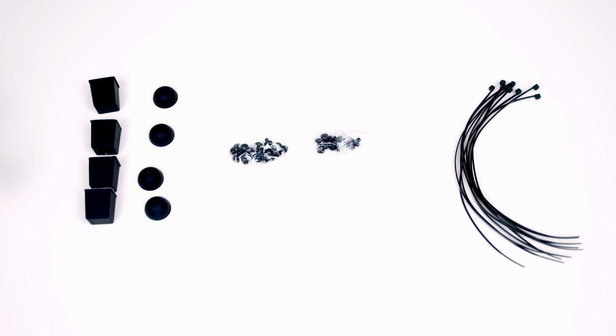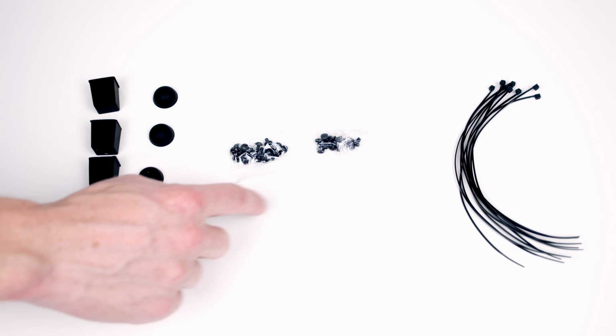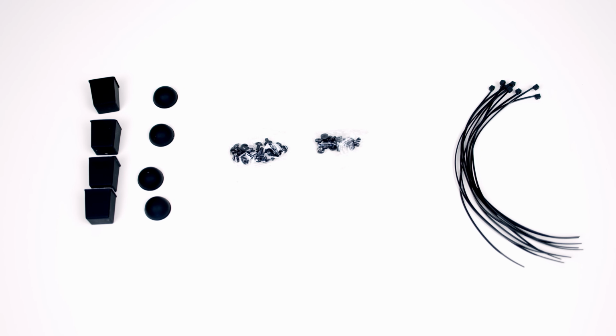So this is what comes in the case accessory bag. As we've mentioned, you've got 2 sets of legs for the case in 2 different heights. You've got 2 packets of screws. There is 1 screw that has a little lip around the outside of it, and then the other screw is completely flat. The one with the little lip around the outside is for securing the motherboard to the case and also for securing 2.5-inch drives to the case. The one that's completely flat is for securing your power supply to the case and also for securing 3.5-inch drives. And then we've got some cable ties for cable management.